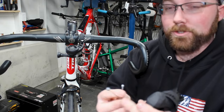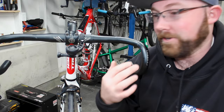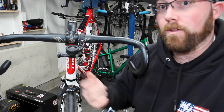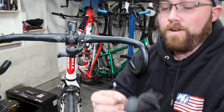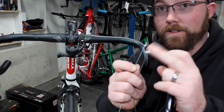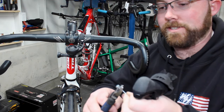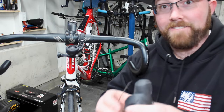When you get brand new cables, you're going to get at least two. If you're just doing brakes, you'll get two cables — one long and one short. The front one is the short one since it just goes from the lever down to the caliper. The back one is your long cable going all the way to the rear. For a road bike, you're going to use the little mushroom-top cable end. The other end is for a mountain bike style brake lever. Since we're using the mushroom top, we'll cut the mountain bike style end off the cable — they give you both so it can be used either way.